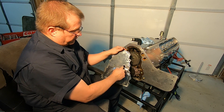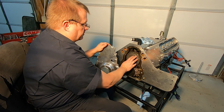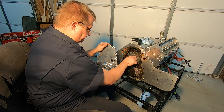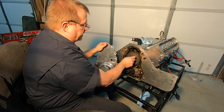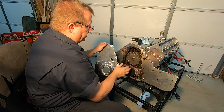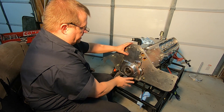As you can tell on this two-piece timing cover, it has a provision here in the front, and this is where the cam sensor will actually go into. So once you've got your timing gear in place, tightened down, and torqued to the right spec, usually I use some Loctite — like blue or red Loctite — on here to make sure these things don't back out. Once you've got that on, it's as simple as getting your timing cover in place and getting it bolted in.